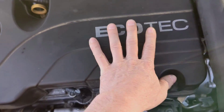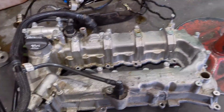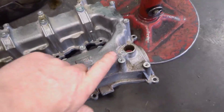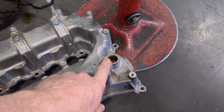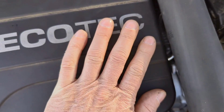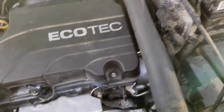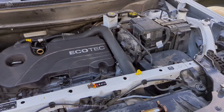If you find yourself in this predicament, all you have to do is — you will need a 10-millimeter to pull this engine cover off. This is the valve cover right here, and your cam sensor is located right here. All you have to do to find out if this is your problem is unplug your cam sensor. If you unplug that cam sensor and the vehicle starts, I can about 100% guarantee you that is the reason why your vehicle is not running. You're going to want to check out the other video linked here, because there are a lot of different reasons if you have timing codes or your vehicle isn't starting. If you're having cam or crank sensor codes, that video will definitely help.